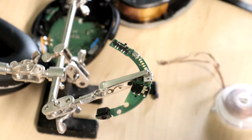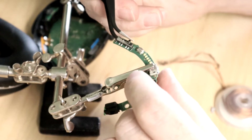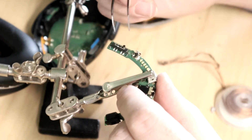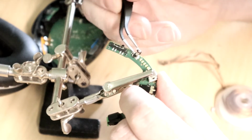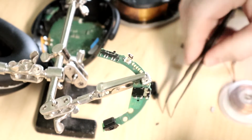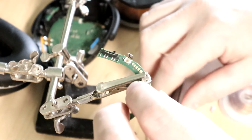Well, unfortunately, that didn't go quite according to plan. I kept getting to a point where the button gets stuck again. So as I tried to work it more and more, I realized that the switch itself was actually coming apart. And if you see, yeah, the whole top came off the switch when I was messing with it. I can push it back down, but that's not really that helpful. Pretty sure the switch in general is just very, very broken. So now I got to figure out, oh gosh, yeah, the innards of this thing, I don't know how much you could see, are just broken pieces of the switch. There's a couple pieces that came out.